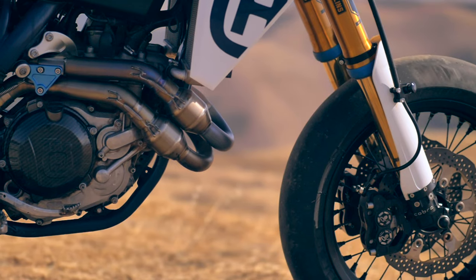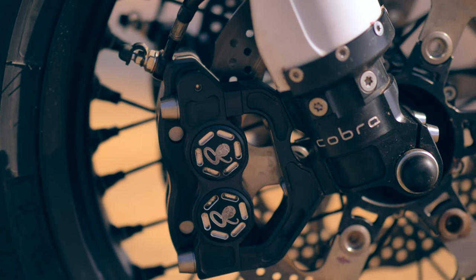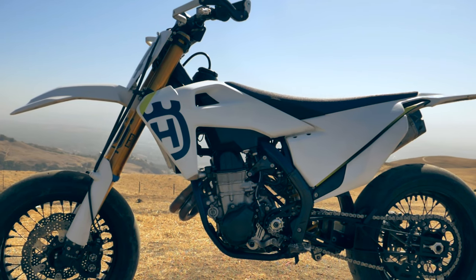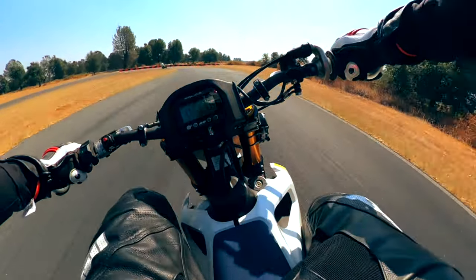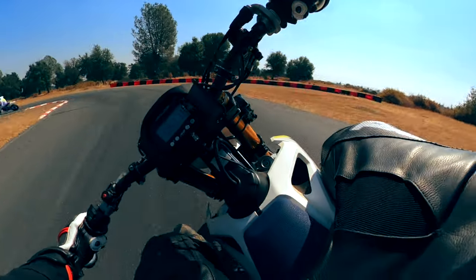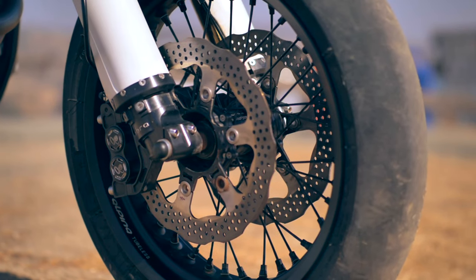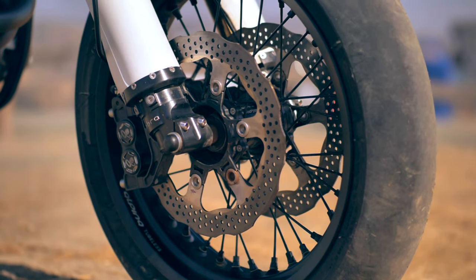I have a double disc braking system from PC5 Cobra that's fitted to custom fork bottoms from the same company, fitted to a pair of RX-48 Öhlins front forks. In my personal opinion, the double disc braking system provides better brake feel, and you also have to use less brake pressure for the same amount of brake force. The downside is that you're adding a little bit of weight because you're adding an additional brake caliper and disc.